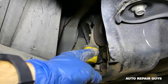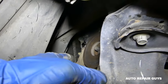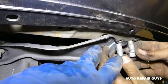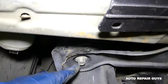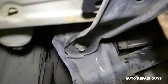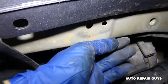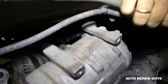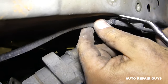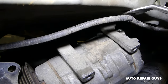Some people are able to pull the compressor through directly, but we couldn't. So what we did was loosen one bolt one revolution and remove two bolts with 17 millimeters to get clearance. Do not remove that bolt all the way because your suspension will drop. Twist that aside, and remove the wire clip so we don't damage it.